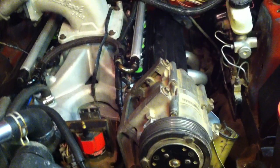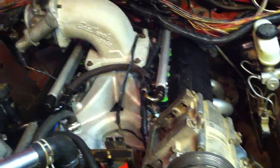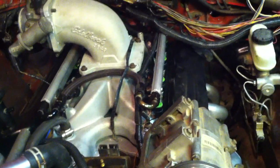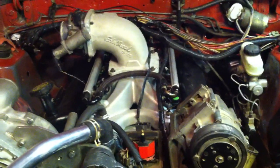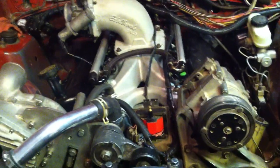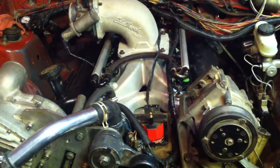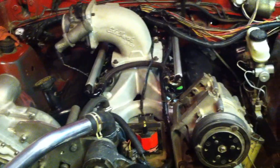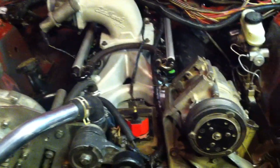The other thing to worry about is your flywheel or flex plate — depending on whether you're doing a manual or automatic — it's a 28-ounce imbalance versus the 50-ounce imbalance that the 302 has. You'll need to make sure you get a 157-tooth flywheel with a 28-ounce imbalance. Late Model Restoration Supply has a really good tutorial and parts list on their website — I'll put a link in the description. I got my headers and drop motor mounts there; my flywheel I bought off Jegs — it was a Ford Racing billet steel flywheel — but as long as you get a 157-tooth flywheel or flex plate with 28-ounce imbalance, it'll work just fine.